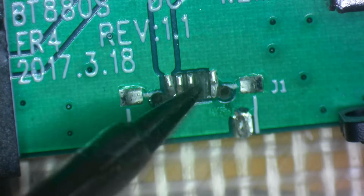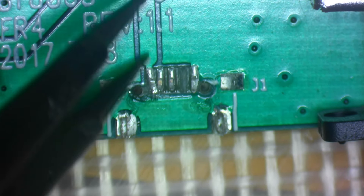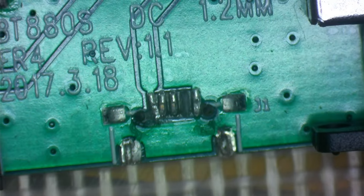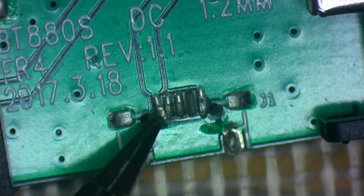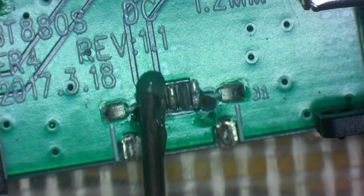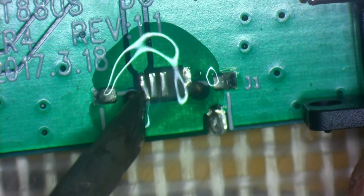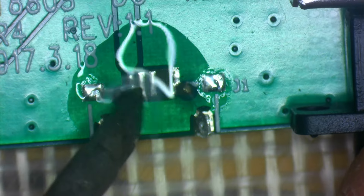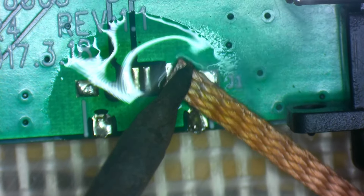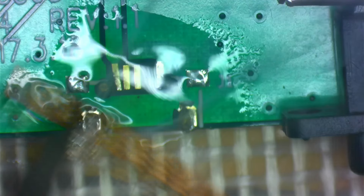So we've got this which looks like it goes to ground — if I'm not mistaken, this is a no-connect. This one here I suspect is going to run straight up and provide us with some power. Let's get some flux on this and try to clean it up; hopefully these pads will stay where they are. I wonder if we can get away with wicking that off without hurting the pad — beautiful. Let's try and clear these ground holes out. Actually, that's not even a ground hole — that's a ground pad.